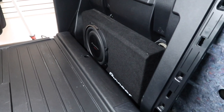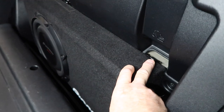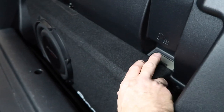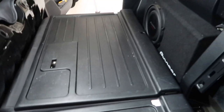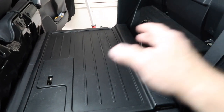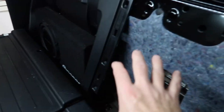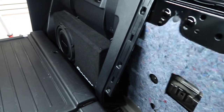For a subwoofer — the joys of picking the right one. He works out of this truck and leaves his seats folded down all the time, so there are really two choices. The Pioneer factory box with a 10-inch fits right in. We're going to make metal clips that attach here and screw into the box using the child restraint clips so it doesn't move. This will be down most of the time since he needs it for putting stuff on.